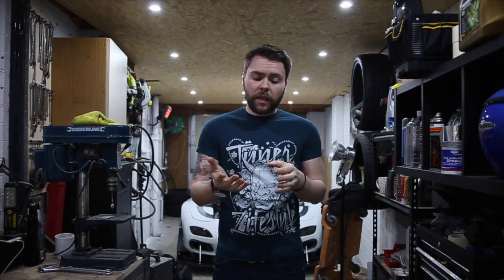This episode we're going to be upgrading the ignition system on the RX-7 to a set of AEM smart coils. Now I bought the whole kit from DM-Motorsport, and with that you get 4 coils, a mounting bracket to locate them where the air conditioning unit was, and a plug and play wiring loom. There's only a little bit of messing you have to do to the wiring loom, but it's only small. So let's unbox and see what we get.